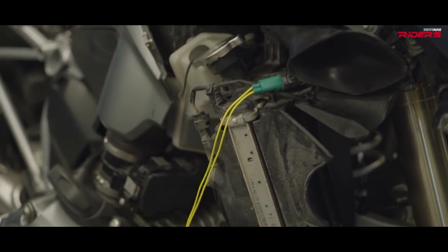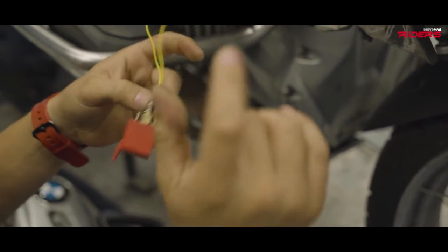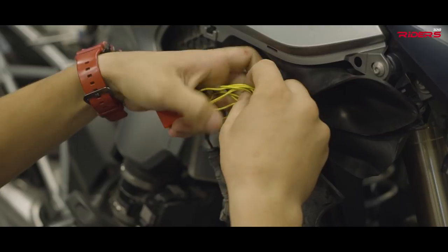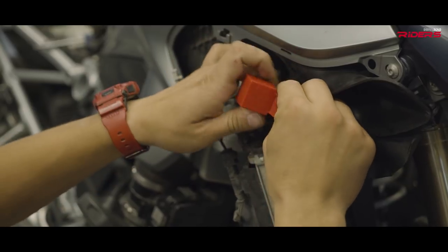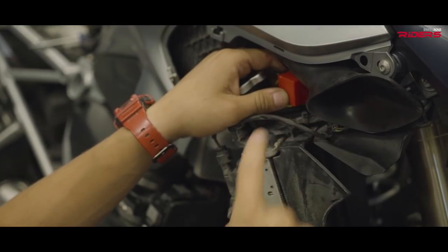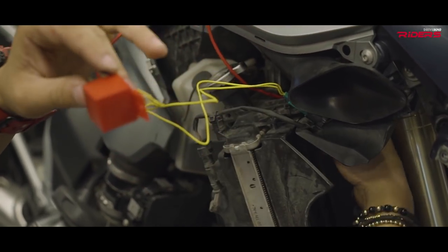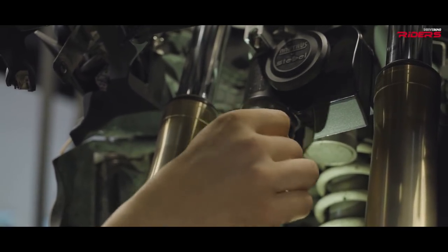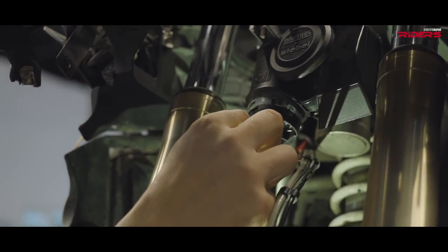Plug in the horn, plug the relay so it will open only when the key is on. I need to find a place to fit it on the bike. The extra wires I need to fit very tight somewhere — I think this might be the right place. Then I'll connect the wires for the horn. Positive goes exactly to the horn. My wire runs nicely along with the braking hoses and then I have to be careful where I plug the red wire — it should go to the positive.